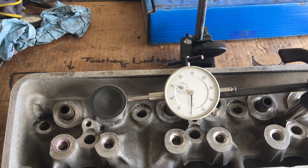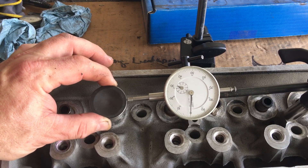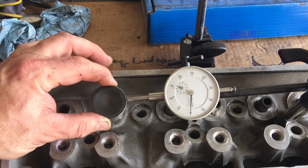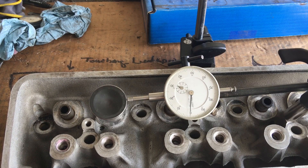So we replaced those, and in the process I was rechecking the valve guide clearances and my heart dropped — we definitely did not want to run into this bag of worms: having K-liners put in, all the associated machine costs, delay the project. But I wanted to make this quick video so Daniel could see what's going on as far as that clearance on the guides, which seems excessive to me.